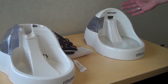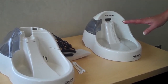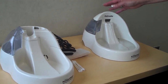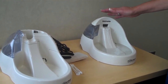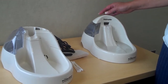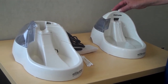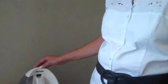Regular maintenance on a fountain like this would just be rinsing it with soapy water, rinsing it out regularly when you refill it. But if you're noticing that it's starting to make noise — right now you can hear it's completely quiet — if it's starting to make weird noises, it's likely that you're going to need to address the pump inside. A lot of times people don't realize they need to maintain that pump, so today we're going to show you how to get to it and keep it clean. If you have hard water, that is definitely necessary.